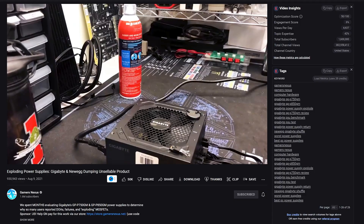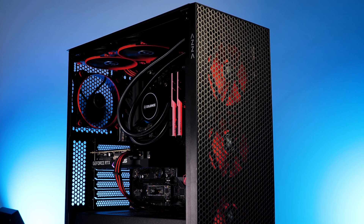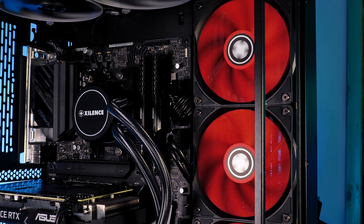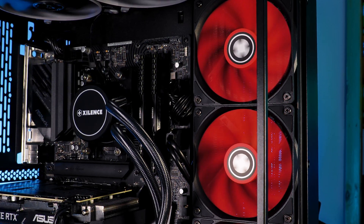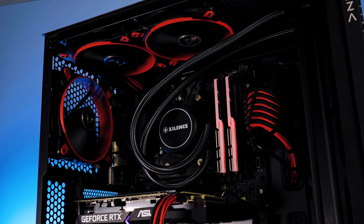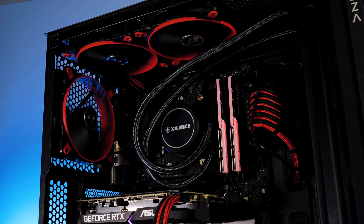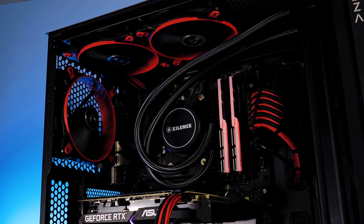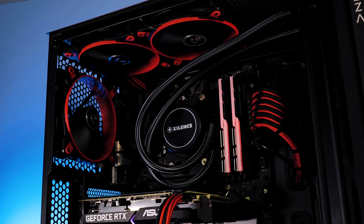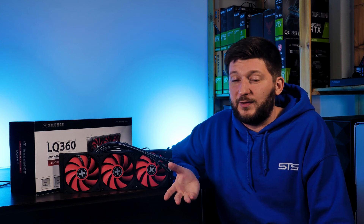But there are motherboards that have an issue properly detecting between 3-pin and 4-pin headers, especially Gigabyte motherboards. What Xilence did here is directly attach a 4-pin to SATA power adapter to the pump. This does two things: first, the pump will run no matter what — Gigabyte can't mess it up. And furthermore, the pump will run at 100% speed no matter what. Usually that wouldn't be ideal sound-wise, but this thing is so damn silent I cannot hear it. So Xilence made sure the pump has a fallback connection for people who don't know how to switch their motherboard to 4-pin mode, and due to the pump being so quiet, there is essentially no downside to this approach. Plus, I now have a useful 4-pin to SATA adapter.